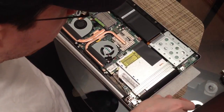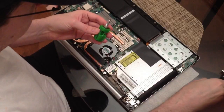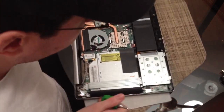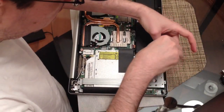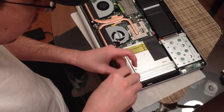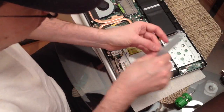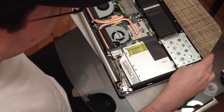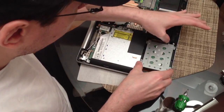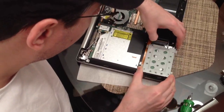I'm going to go ahead and take out the hard drive — this is a 1TB 5400 RPM hard disk. I have a little miniature Phillips head screwdriver. There are four screws around the edges. I've skipped ahead and taken those out. There are two other screws right down here holding on a bracket for the optical disk drive — I'll go ahead and take those out and remove that bracket. Then you can lift up. The hard drive is now loose, connected to a little circuit board. I'll hold the circuit board still and just pop it out.